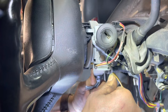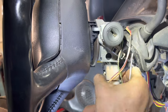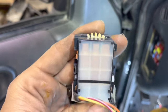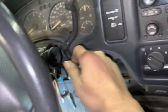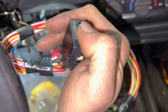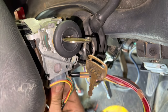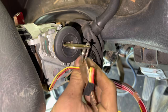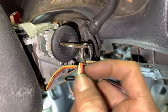Release one side, pull down, then release the other side, which will allow you to pull this out completely. Notice that the notch is over here in the corner — looking at it from this perspective, that's exactly how we need to reinstall it, so it notches correctly because this is clocked to the vehicle. Insert our key, turn the key backwards one position, then insert the switch. Roll the switch all the way clockwise so we have the two big notches right there, then simply insert the switch and click it into place. Run the key indicator up through its pathway, click it into the top, and plug in the security lock. Note that if you have a security problem, replacing this switch more than likely is not going to repair that.